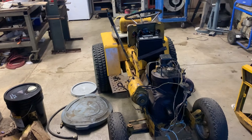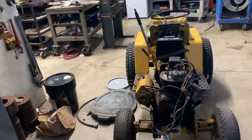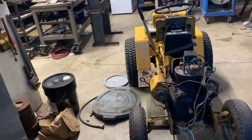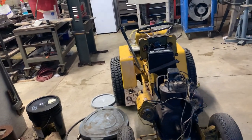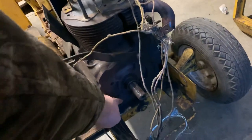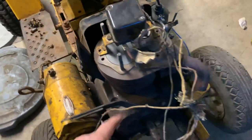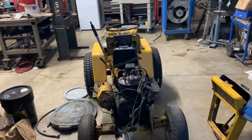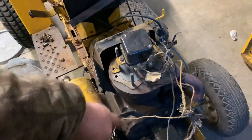So that is how you know if you have balance gears or not. What he told me was they had a hard time getting the oil dipstick to go in if the engine had balance gears, which I found kind of odd because I have engines that had balance gears in them — I got rid of them. The oil fill tube was right there in the top of the block, and right here is where the balance gears mount, and right here's the dipstick. It's back a little bit from the balance gears; however, it is fairly close. So that is actually why they did that. And if you ordered the engine without balance gears, the dipstick tube would be up here instead of down there.